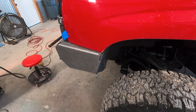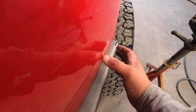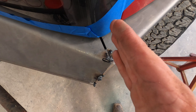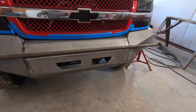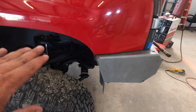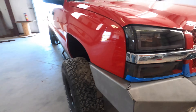She's all tacked up. I made sure these lines came in smooth, matched this side with the other side. Need to pull it out just a hair but I'll do that in welding. Everything's tacked. There are a few gaps, but that's just so I could get it where I wanted it — once it's all smoothed out, it'll look pretty good. It's all the way around looking the same, very good contour. Obviously we'll have to cut some things once we get it all in place. I'm going to go ahead and remove it so I can get it off to the side and start welding it up, and get the original bumper back on so I'm not driving around with no bumper.